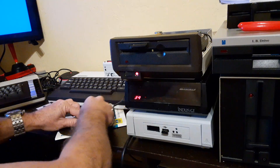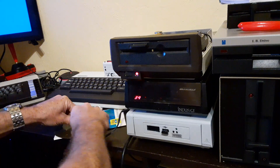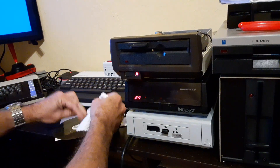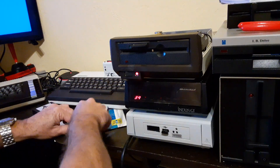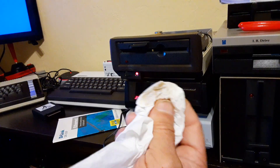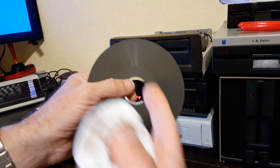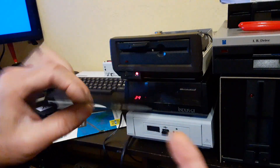So I'll go ahead and take the alcohol and clean. This is actually mounting a naked floppy — I'm not going to bother putting it back in this sleeve. Here's the schmutz off of that. That schmutz is actually oxide — it's an oxide layer from the disc that is loose, and it's what will get on your heads and confuse them. It's actually iron oxide, chromium dioxide, some other stuff, finely divided — as chemists say, ground real fine — and then mixed with a binder, a glue, and then put on the disc, which is transparent mylar. If you scratch the disc and then scratch the other side, you'll see through it clearly.